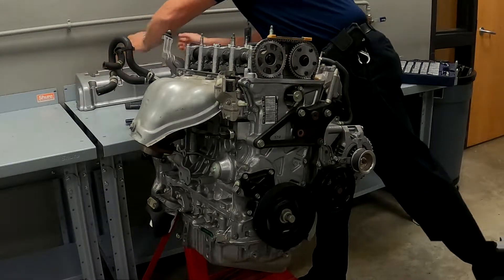There's a mark here and another one right here. We're going to turn this engine over so that we're at top dead center. The white mark on a Honda engine is always TDC. We're lined up — there's a gun sight on the front of the crankshaft on the timing cover, white mark right here on the pulley — and if we look at our cam gears they are lined up also. We are at TDC, number one piston at top dead center.